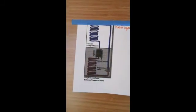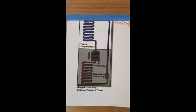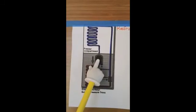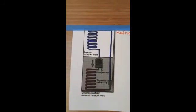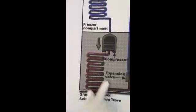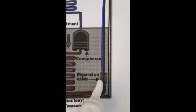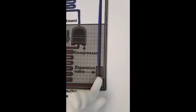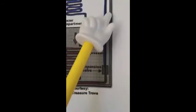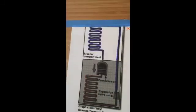When HFC is cooled to about negative 16 degrees Fahrenheit, it turns into a liquid. A motor, or compressor, inside the fridge squeezes the HFC, heating up the gas. The expansion valve takes the hot gas and expands it, re-cooling the refrigerator. And it just goes in a circle.